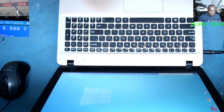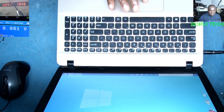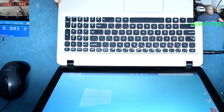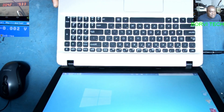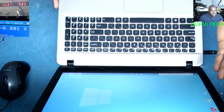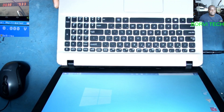Here, when you go to the battery icon you can see it appears to be charging — the meter is counting as if it's charging. But when you check the power supply, you see it's only taking 0.43 milliamps. That cannot charge your battery. In my first video I thought the laptop was flat and that's why it wasn't charging, but after leaving it for so long it still wasn't charging. That's why I decided to make this second video to fix this problem.